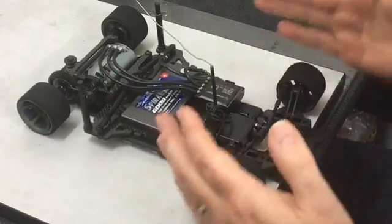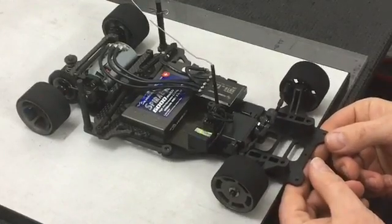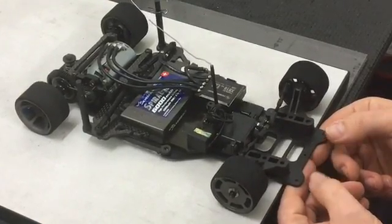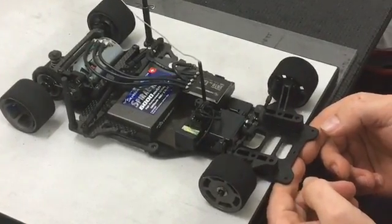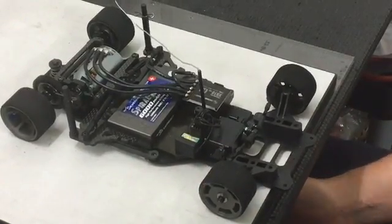For me, I just check this visually. I just lift the car, we know the car's tweaked straight, so I just lift the car, make the front tyres just touch the flat plate and just release, and just check I can see equal sag left and right. As long as they're equal and they look equal, then the car should drive straight.